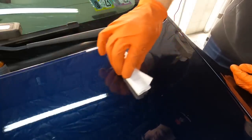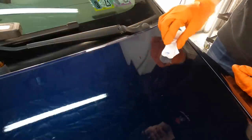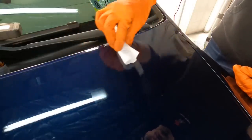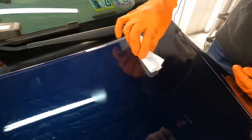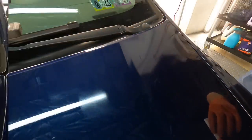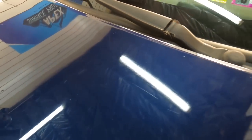Very gently, without a ton of pressure, spread the product on top of the scratch and go a little bit wider than the scratch because we will blend in using their platelet technology compound as well. This is a self-leveling resin, so don't worry if it looks a little streaky or has a little texture — that will level itself off to a certain extent.